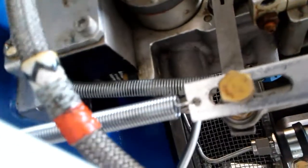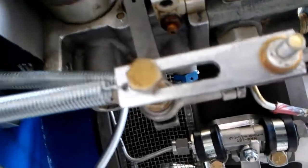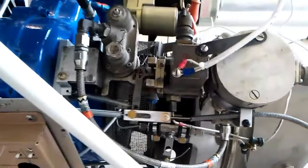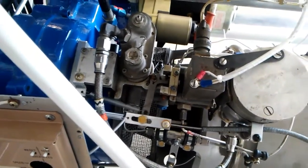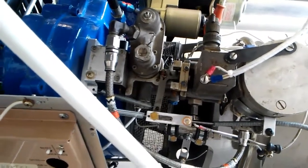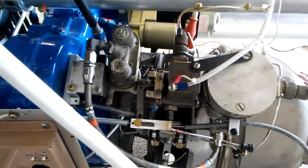The governor — I don't know if you can see this — would still have full range of motion, going stop to stop. If the governor quits, it would move forward, and then you would simply roll in the throttle and you would have control. It might be a little tricky to control the RPM, but this would be better than just having that pull-out emergency. If the governor quits, you'd be able to manually control the throttle and land the helicopter safely.